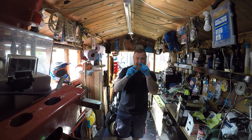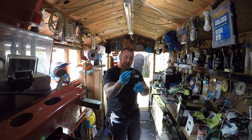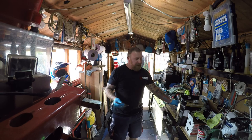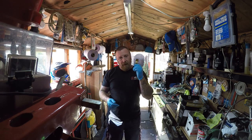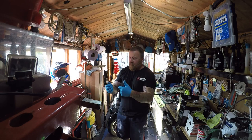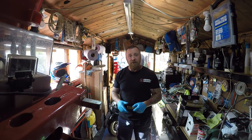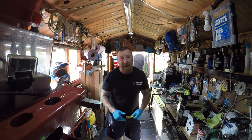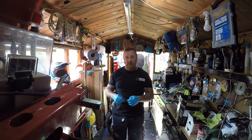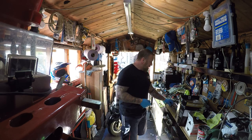This is what you buy — you attach it to the actual frame with some washers and a couple of bigger bolts and that holds it. But to be honest, I've got an impact gun now — seconds, on and off. No hassle. I strongly suggest everybody use an impact gun if you can. If you can't, on the Speedfights the claw hammer works, and also on the Aeroxes. But it won't work on these little GY6 engines.